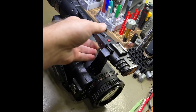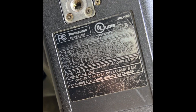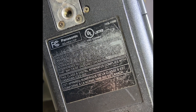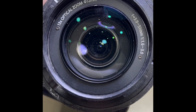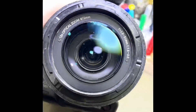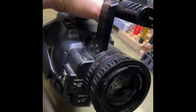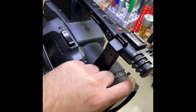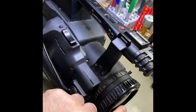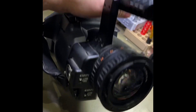I'm working on this Panasonic video camera, it's an AG-HPX175P, and the issue is that there's mold in the lens. We're going to have to strip this down and clean it out and get that mold off the optics. The only way we can access the lens is through the back — nothing comes off through the front, only the barrels. The screws are in the back, so we're going to strip this down and hopefully it turns out nice and clean.